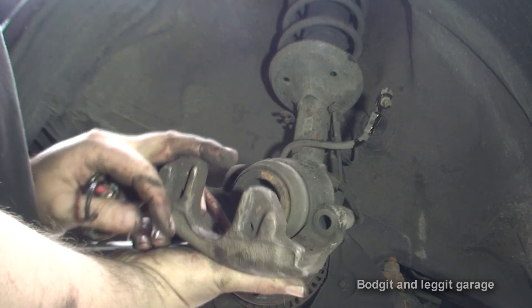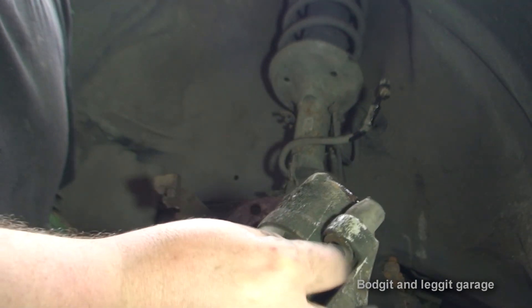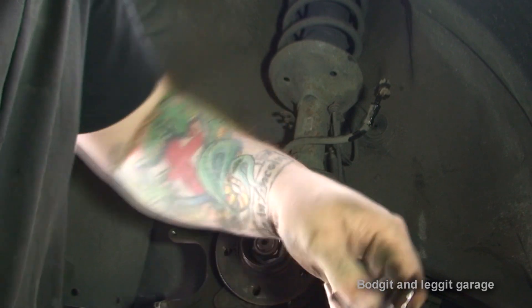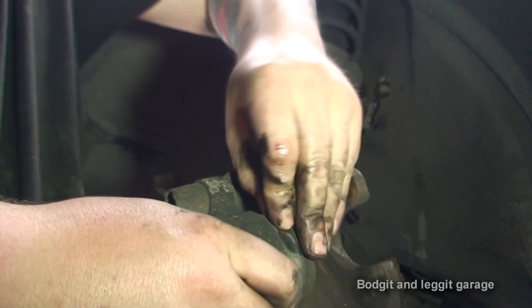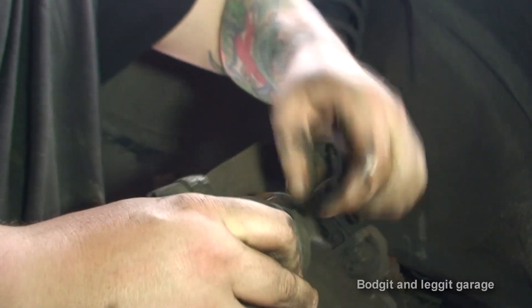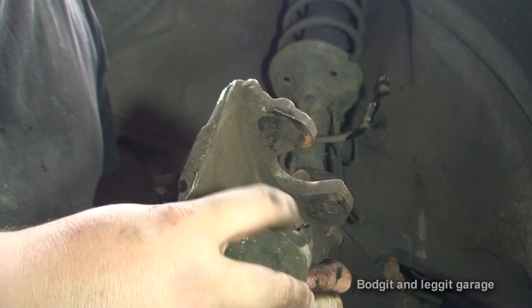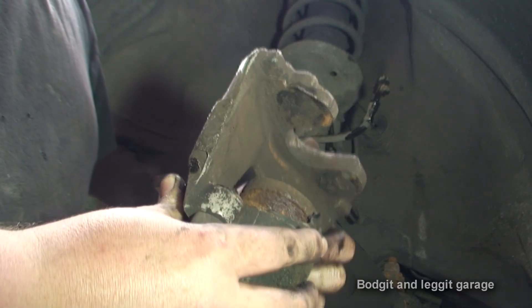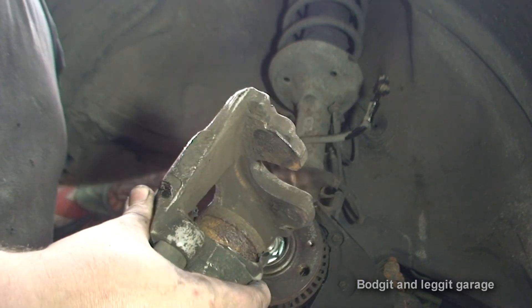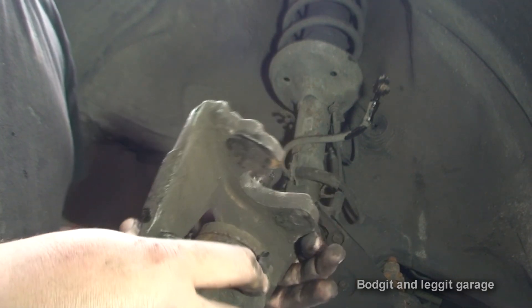Again, front caliper — seized. Make sure there's nothing on it that you're going to need. Actually, look — there is a split in it. And here we can clearly see what happens when a boot splits. If I just pull all that off... see how rusty that is? That's supposed to be polished like a piston in a car — because it essentially is a piston. That has to be really nice and clean so it slides smoothly. That little crack in the rubber has seized it and made it rusty, so it will not slide back — which is what's done the damage. So that's what you have to be very careful of — do not damage that rubber. It is vitally important.